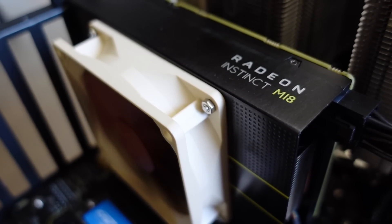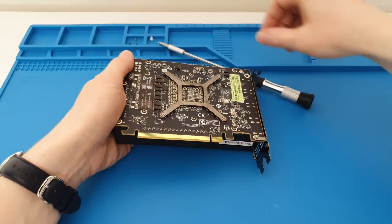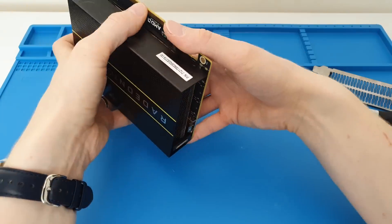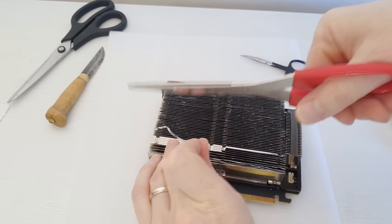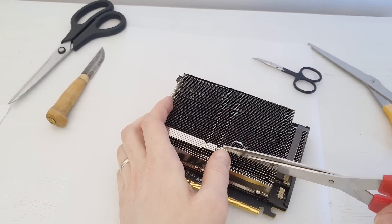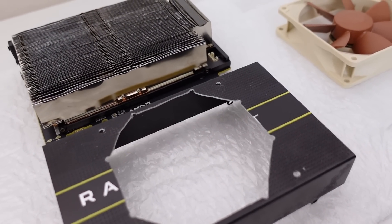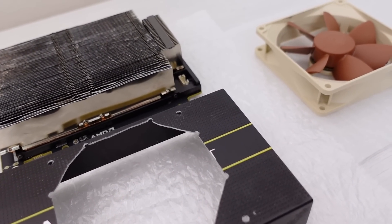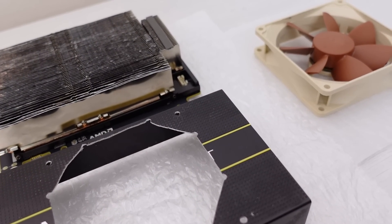First we need to figure out how to cool down this thing. There are multiple different options, but I went with the simplest one. I removed the shroud from the GPU and then took very technological equipment such as scissors and simply cut off some small pieces from the top of the radiator to have the fins open. It took quite some time, but I managed it. The next step was to drill some holes in the radiator to mount the fan and cut a piece of the shroud to have the fan blowing air through. Right now I have the fan mounted and here is the shroud piece I cut out — it doesn't look very even, but it does the job.